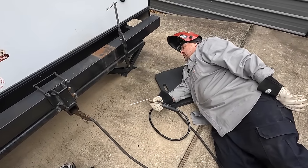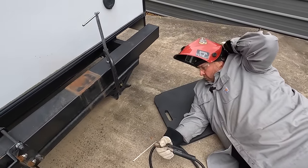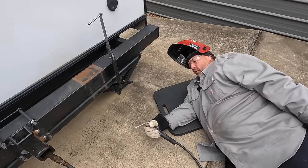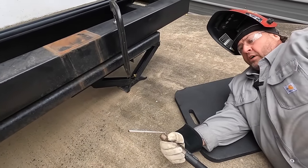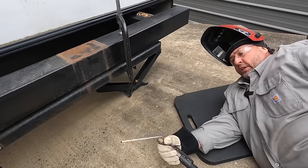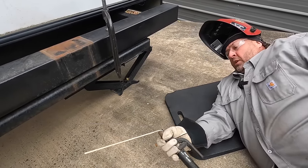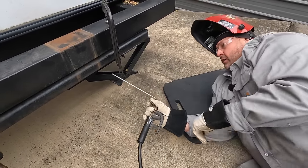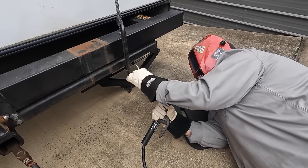On the ground — my favorite place to be working on campers and vehicles. I'm going to get these angle pieces tacked in place so I can move the clamp out of the way. I realized after clamping them on that I forgot to wire brush the paint, so I'll just use the 7018 and burn through it. Once tacked I'll take the wire brush and brush it real good — it'll be just fine.